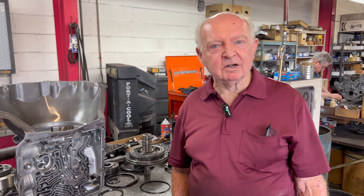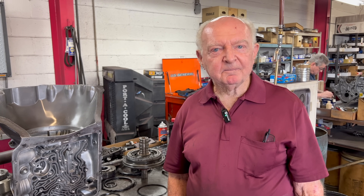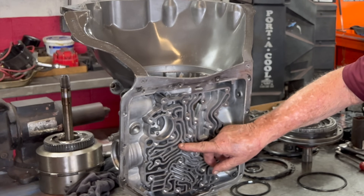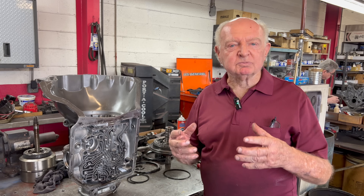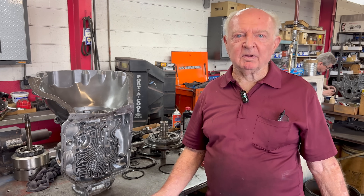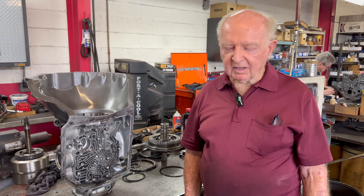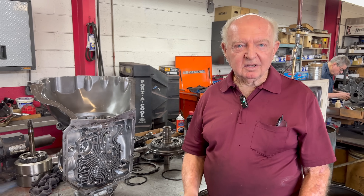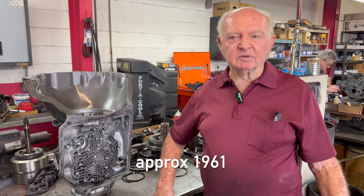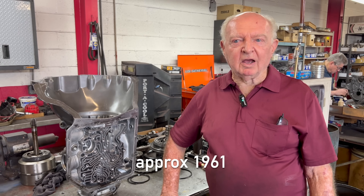They made them reverse shifting and manual shifting transmissions. If you put it in low gear, that was high gear; second was second; and drive was low gear. That's just the way they did it when they cut those notches and drilled holes in the valve body — it shifted backwards, but they were positive shifting. If you put them in second gear, they stayed in second gear no matter how many RPMs. It would never automatically take over — it was not an automatic, just a solid shift transmission.